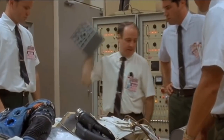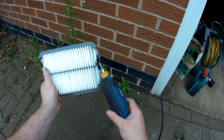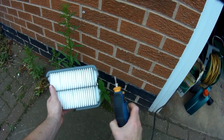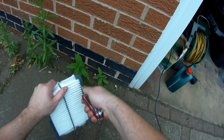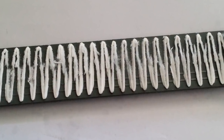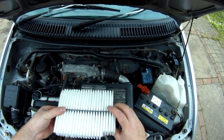We've got to find a way to make this fit into the hole for this. With my high-end premium air filter in hand, I immediately set to it with a Dremel and a cutoff disc to separate the outer housing, then removed it by cutting through the very edge of the filter material. The material is actually moulded into the plastic, so this is the only way to get it all off. This left me with the core of the filter, which is what I'll be making use of.